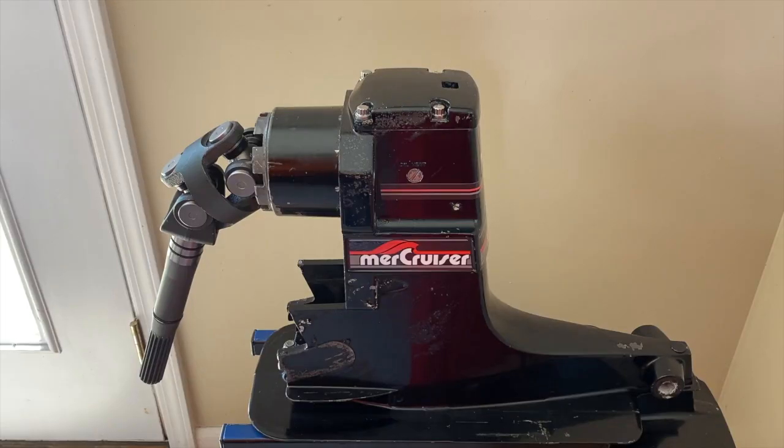What is trailer position? Take a look at your shift and throttle lever. Depending on the boat, you will have your trim lever and either below or above it will be a trim button. You push that when you want to bring the out drive to the absolute fullest up position. They call it 'trailer' because in most cases you use that trailer button at the end of the boating day after returning to the dock and no longer in gear — just prior to turning the engine off, you push and hold that trailer button, raising the out drive to a higher setting than the trim lever can achieve.